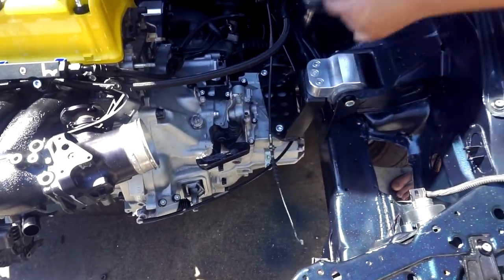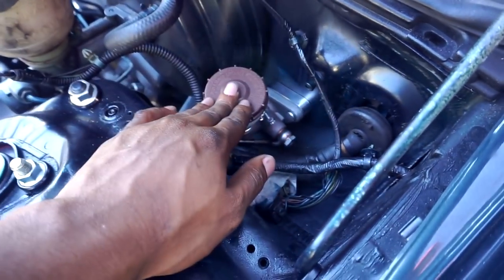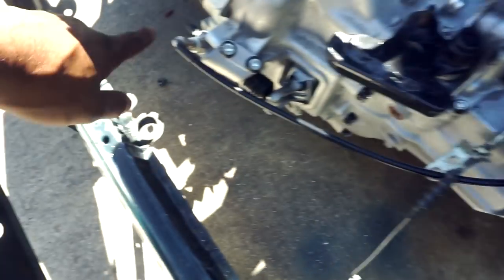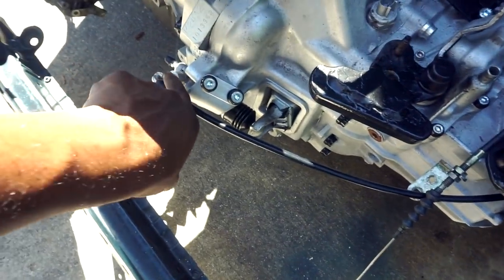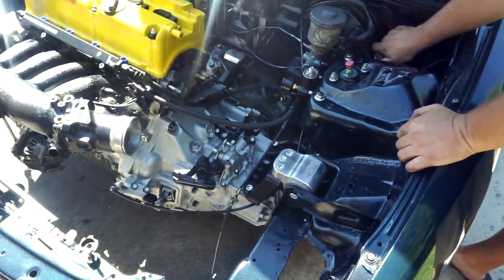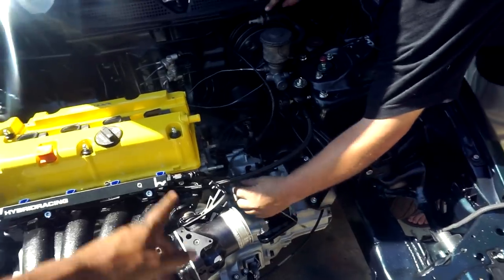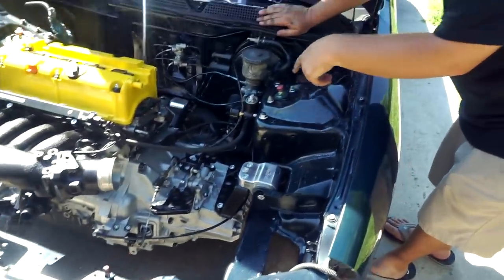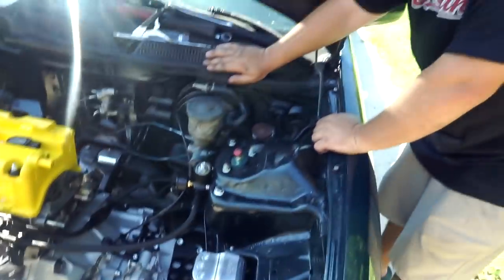The kid I had before didn't know - he was running an S2 Cayman, so if you use a factory clutch master cylinder it'll work fine. What was different on mine - I had the 180 going downward so it can work, and now that's all tightened up. Now I can bleed the clutch, have pressure, and now I have fuel. So what's left is just tightening the manifold up with a gasket, throttle cable and all that. Getting the car to crank - that's it. I just had to flip the other end around, same length, same everything, tucks under the mount the same way.